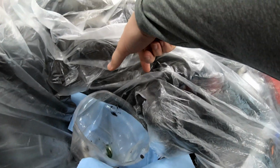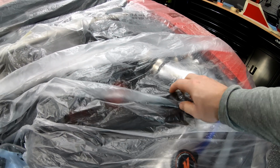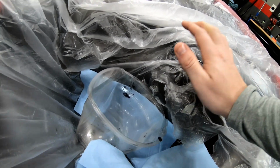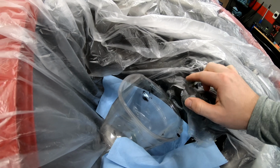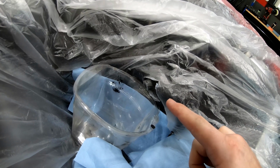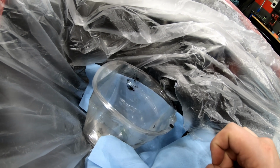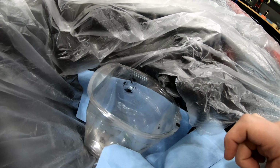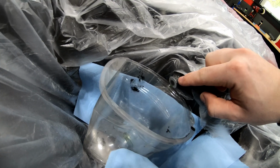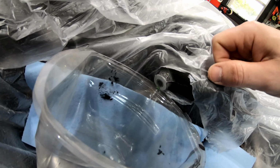There's a radiator neck that's coming from the 1J, and it comes into the top of the radiator over here. And this, I can't remember exactly what it was for, but it was some coolant port. Back in the day, several years ago, I actually filled the hole with some kind of steel epoxy or JB weld, and at the time I had limited knowledge. I don't know back then what I do now, and this was several years ago, and it's lasted, but now it looks like the material is porous, and it's just coming through the JB weld just ever so slow.